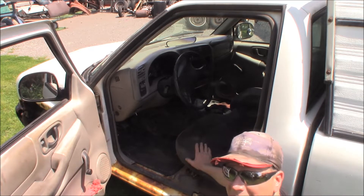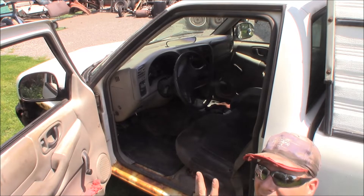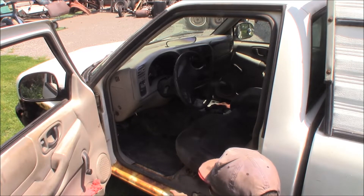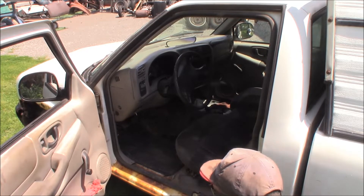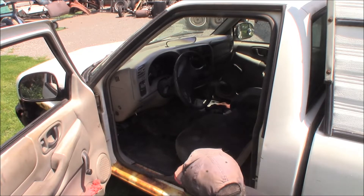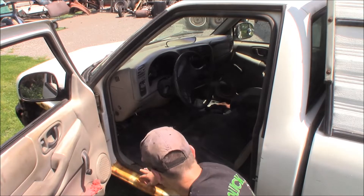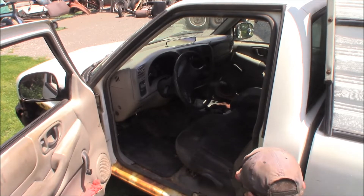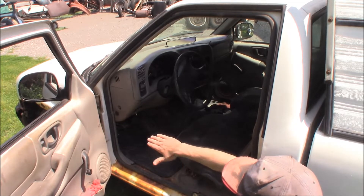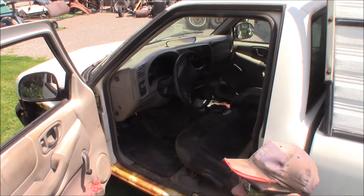Here's the interior. I swapped in a set of bucket seats out of an extended cab S10. I've got four S10s worth of parts in this thing. You can see here that my rockers and floors I put in are starting to rot again. I've actually got rot up above where I tied the rocker in up to the door post. The floor pan is solid here, but it's got a rough spot on the rockers. The problem is the cab mounts are shot — the cab is actually leaning on this side and rattling around.